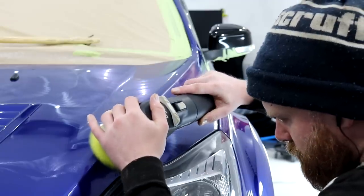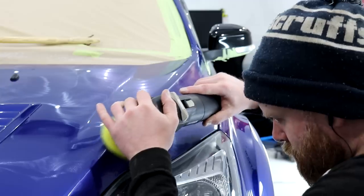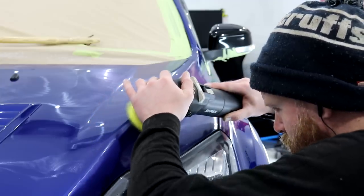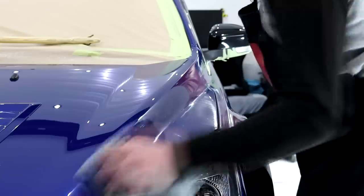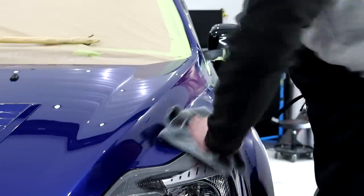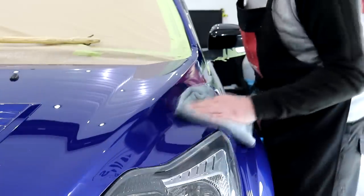We should now be able to see a clear difference from polished versus compounded, and in all fairness, there will be little to no work left to do after this initial polishing stage. This fine abrasive refining stage is removing 100% of the medium compound abrasive marring and leaving no further marring behind.